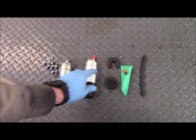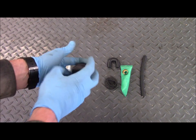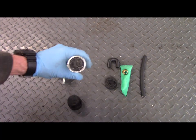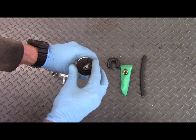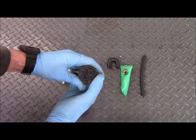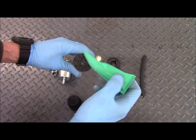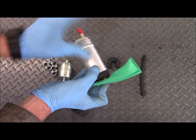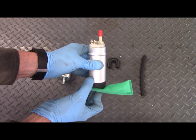The fuel pump has a little protective cover on the bottom that pops right off, and then the vibration isolator slides right over like that, and then the particulate screen snaps on the bottom of the fuel pump.